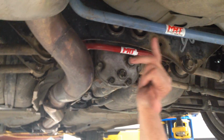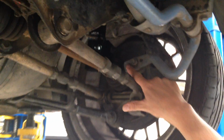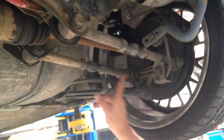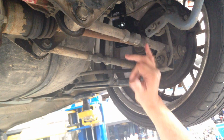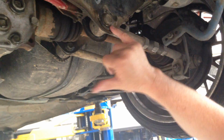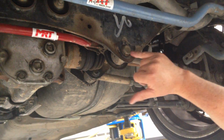So we've got the Whiteline rear adjustable sway bar. Again, it's got the 3 settings. It's got the stiffer setting here, medium and soft. It's got the complete replacement lower control arm kit, which allows turnbuckle adjustment for the toe and the track, so you can widen the car or narrow the car and control the toe through these turnbuckles. The original factory wheel alignment mechanism has been deleted.